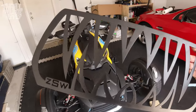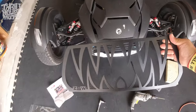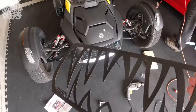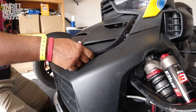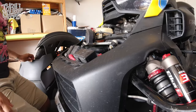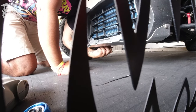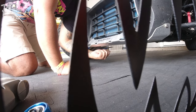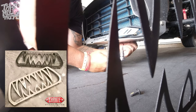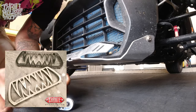That's the exact same size drill bit mentioned in the instructions, and that's the grill on its own. It has four tabs that stick out — you have to drill into that front fascia, just into the plastic, and drop those bolts in. It's got little nuts that lock it down on the opposite side. As you can see, it's a flat black powder coat, so there's definitely a good coat on there — it's not just spray paint.